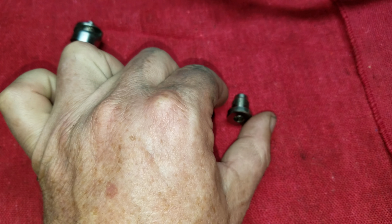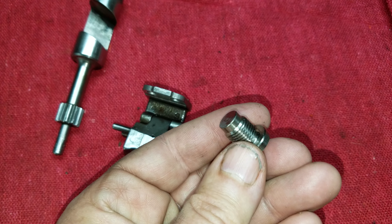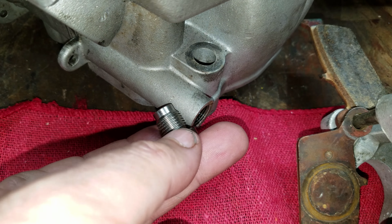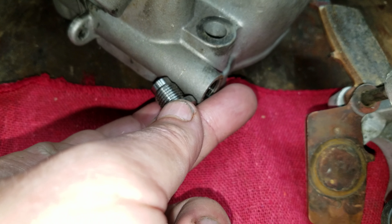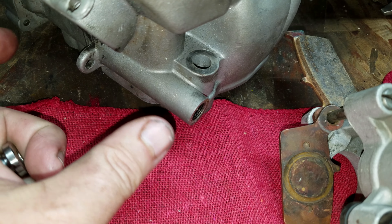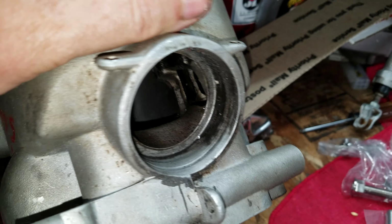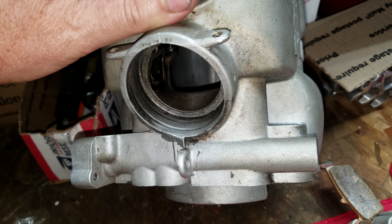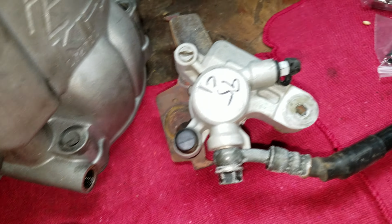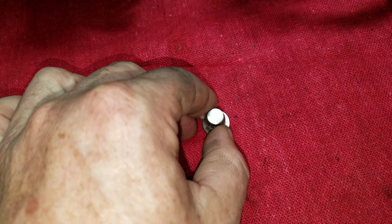And then another thing you can do is the Kips bolt modification. What that does, it goes in your cylinder here, and by controlling how deep it goes, or how far back this way it goes, that rod inside there will move. And so what I like to do is adjust it while I've got the valves in there, which this cylinder does not have the valves in it, and take up some of that slack that's in there. But making sure, of course, that the valves open and close correctly once you've got it in there.